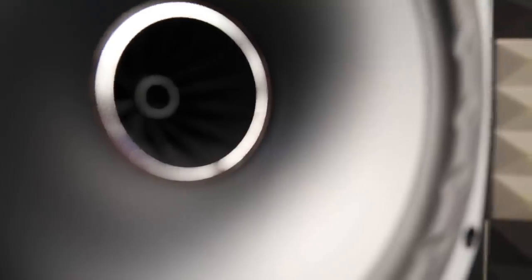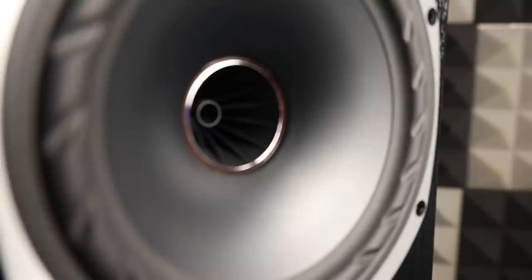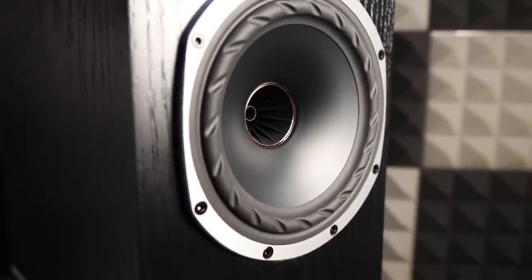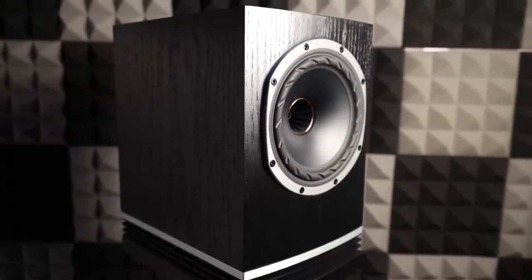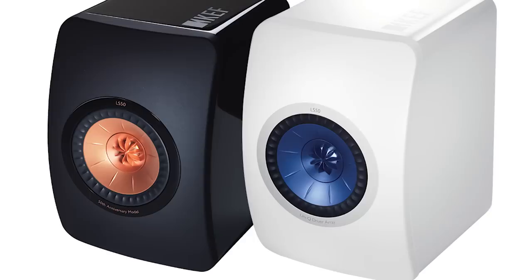The tweeter itself is a compression driver, which is normally found in horn-loaded speakers, and the actual waveguide is called their ISO Flare technology. I think the reason why I get such great depth is how they time-aligned the tweeter and the mid-woofer, and how the tweeter is actually a bit more recessed compared to the mid-woofer. It's different when listening to KEF LS50s — they are a bit more forward, but they still have that great imaging prowess.